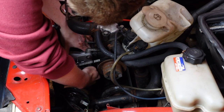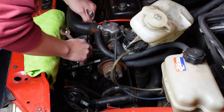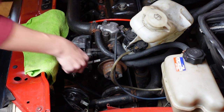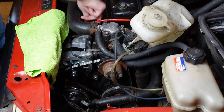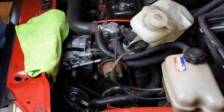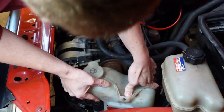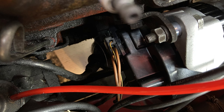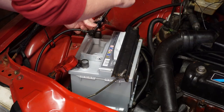The new belt was something I'd ordered before I noticed the car wasn't charging properly. With the belt threaded correctly around all three pulleys, the alternator itself can be adjusted to apply tension on the belt. A socket on the adjusting nut holds it in place so I can tighten up the pivots. The belt will have to be re-tensioned in a couple of days once she's been driven, but it'll do for now. Once the new plug is loosely fitted upside down into the side of the alternator — because quality — we can reconnect the battery.